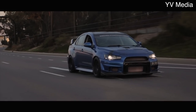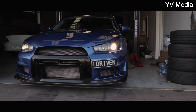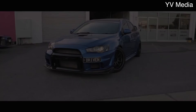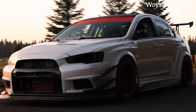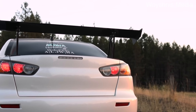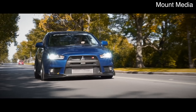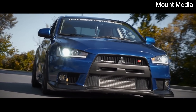What makes the 4B11T such a good engine is what's on the inside. The square bore and stroke ratio, dual MIVEC, efficient turbocharger, and most importantly the strong engine internals are what makes this engine so great. The 4B11T bottom end is very well known for being very strong and able to withstand huge amounts of power, though it's not quite as strong as the 4G63T when pushed to the absolute limit. Another notable feature is the four-bolt crank caps, which isn't something you normally see on an inline engine — rather it's something you'd see on a V6 or V8. The pistons are forged and use a fairly low 9-to-1 compression ratio. The connecting rods are also pretty strong, and on a totally stock bottom end the 4B11T is capable of withstanding upwards of 500 horsepower pretty much just fine.